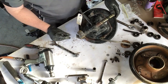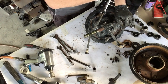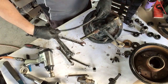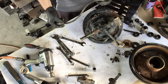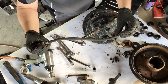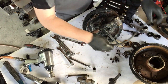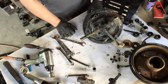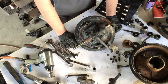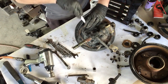Okay, go onto the back again, we'll take off the brake hoses. And there we go, 5/8 Imperial works. One brake hose. Look, I think it's been replaced, but I'm going to replace it again. 20 years ago, I don't know if there's been any fluid in it or anything, or whether it's going to be perished or what, I don't know. So, play it safe, replace, simple as that.